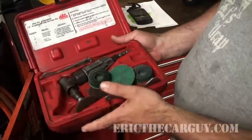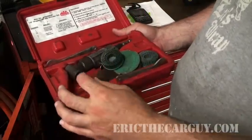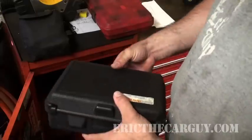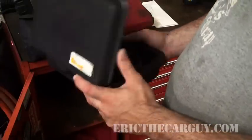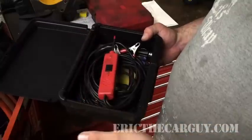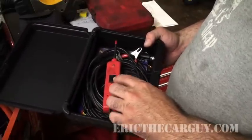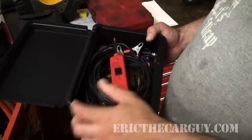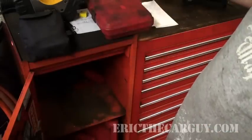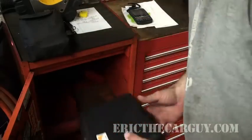An angle die grinder that I use quite extensively. For cleaning aluminum heads I use these plastic things; for cleaning just about everything else I use the cookies — don't eat these. I also have probably my favorite electrical diagnosis tool ever, and I have two of these. This is the power probe, and what it can do is not only tell you if you have power and ground and give you a nice little noise, but you can also supply power and ground to a circuit. We need to be careful of that — we don't want to fry things. You have to know what you're doing here.